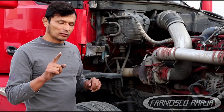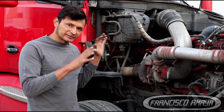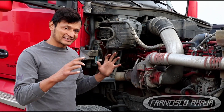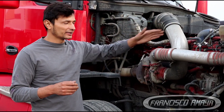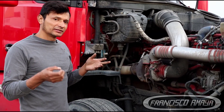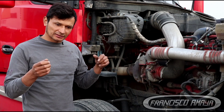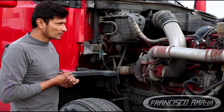It is up to you to find which is the right cause so you can repair your Cummins ISX. Do not replace any component without physically seeing that it is the issue. When it comes to the engine internally, you cannot see it — only when the problem is a large one, like when the engine is starting to blow pressure to the surge tank or the coolant tank. To see coolant dropping inside the combustion chamber, I demonstrated that in other videos where I inserted an endoscope camera inside a combustion chamber of a Cummins ISX-15, and the coolant crack was so large that coolant was leaking even without the engine running.